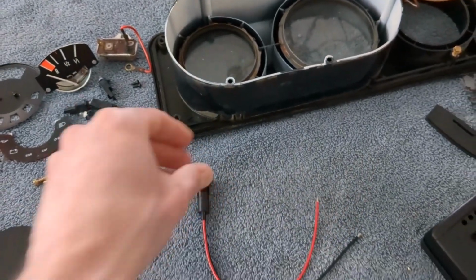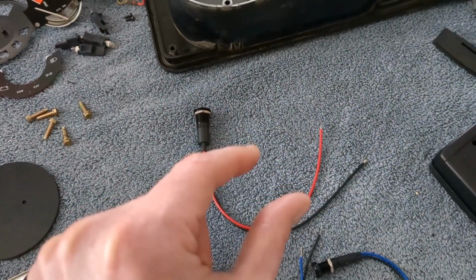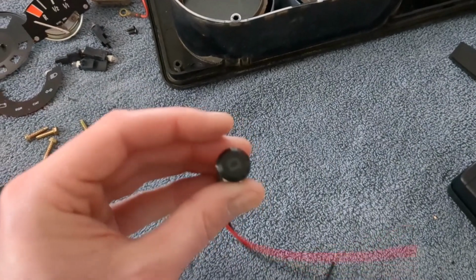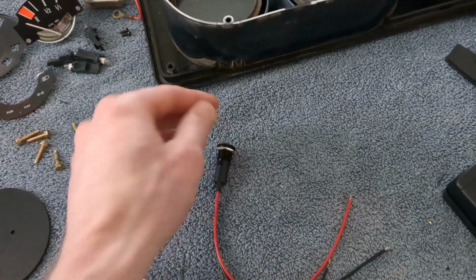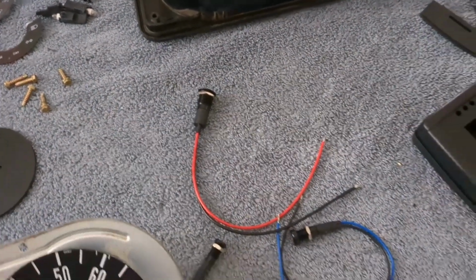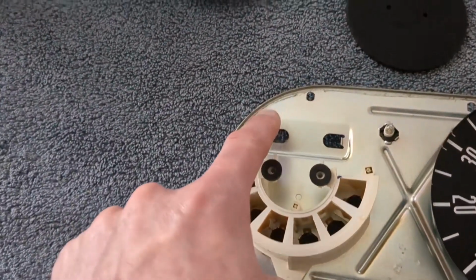And what I'm going to do is I'm going to have a little relay. When the reverse switch gives me 12 volts, it'll flip from the normally closed. This will be on the normally closed, which will light up when the key switch is on, and then the reverse will flip over when the reverse light comes on, and that'll just be like a toggle between the two. And then, so that'll go on these top.